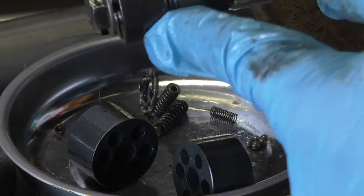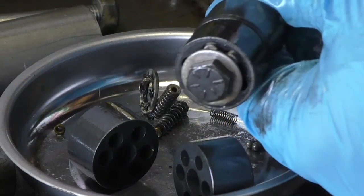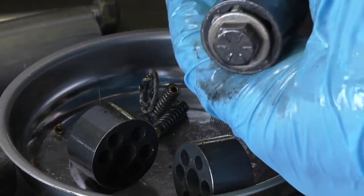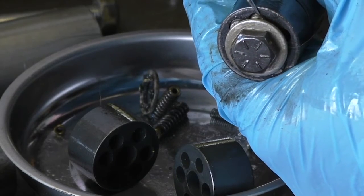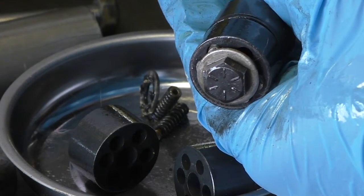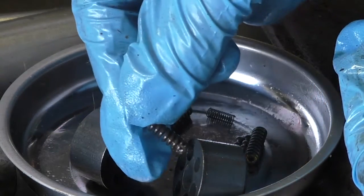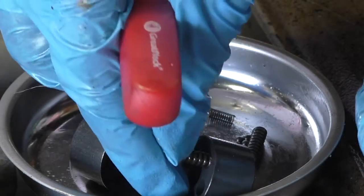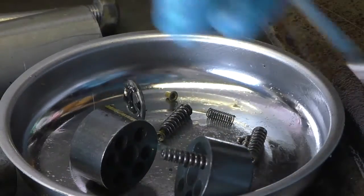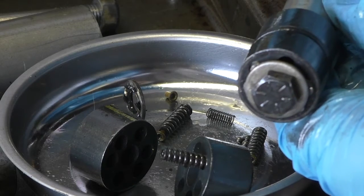There's the piston, there's a seal on there, and if you look at the end, you can see 1, 2, 3, 4 springs with the balls inside there. There's one of these guides with the bushing guide already installed, and that will go with one of the balls into one of the check ball holes in the cylinder, like so. The bolt goes through the outside, or if you're putting it on the old style, that slides all on the shaft, and that's pretty much the whole thing.